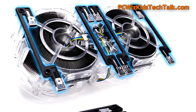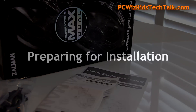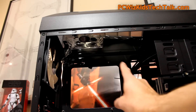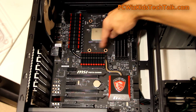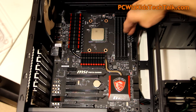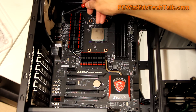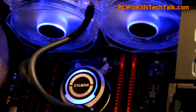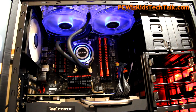Make sure you check the manual of your case — whether it's a mid-tower or a full-tower — to confirm it fits. Compare the specs and the manual instructions. Moving along to the installation: in this Zalman case I've removed the fans to add space, removed the screws and the bracket that came on the motherboard, attached the eight-pin power connector so everything is in place, and then slid the Reservator 3 into place and installed it.